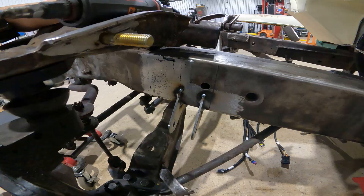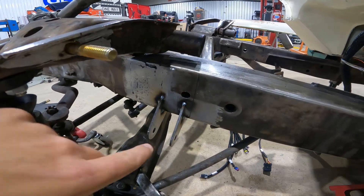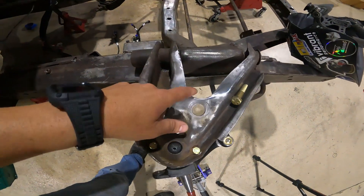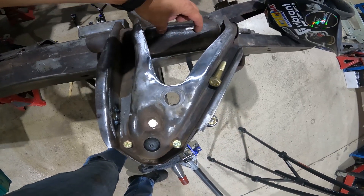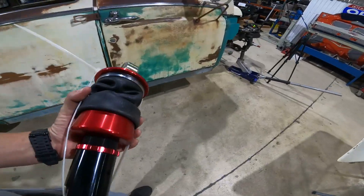A little change of plan — I definitely made a mistake. This setup is not going to work. Some guys in the comments probably already pointed that out. As I put this shock on, I noticed when you air it up it's just going to push the upper control arm up. So we're going to do this the right way — fix the shock on the chassis on top, and put the air shock on the lower control arm this time. Mikey already opened up this side, so the air shock will be mounted here. We'll grab a Builder Series shock and put it right in.